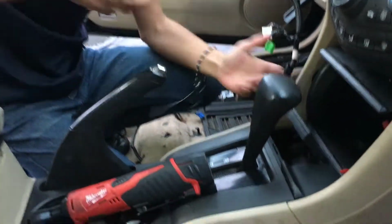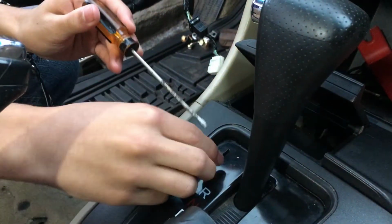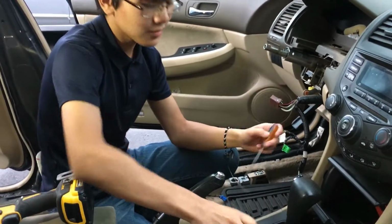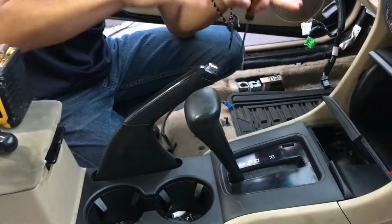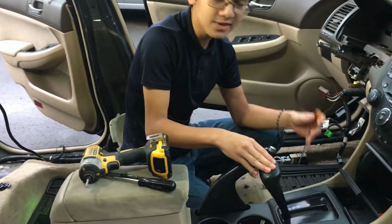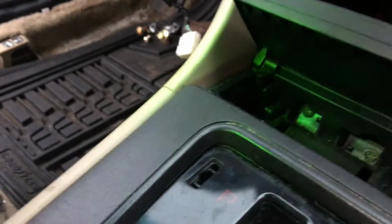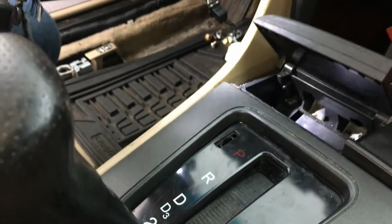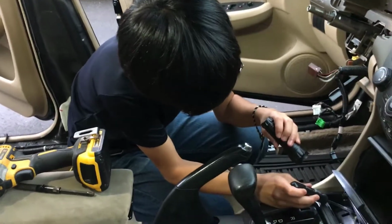And under the ashtray, now you could move the gear shift back in order to make it easier for you to access this. In order to do that, we're just going to push it back. Now, I have a video on this, so go check it out if you need to. I'll link it down in the description below. Now, what we need to do next is, if you look down here, let me get my flashlight. There are two screws that we need to take out, one here and one here. So we just take a regular screwdriver and then take those out.